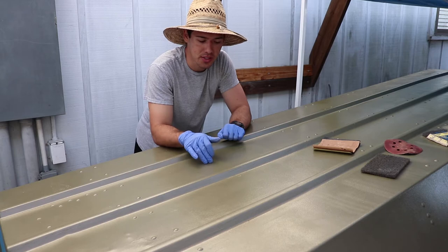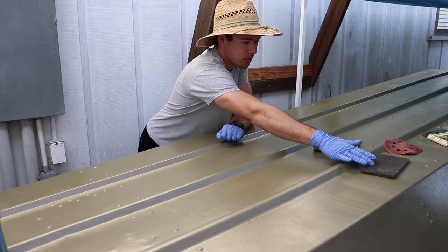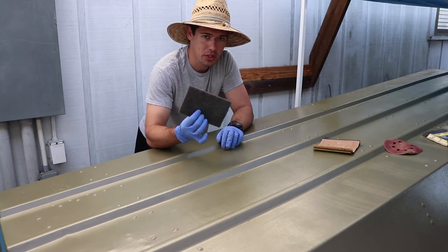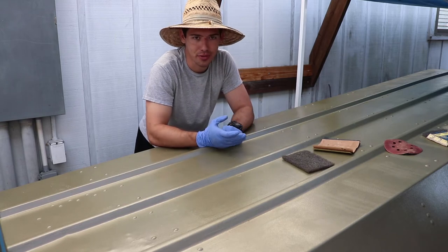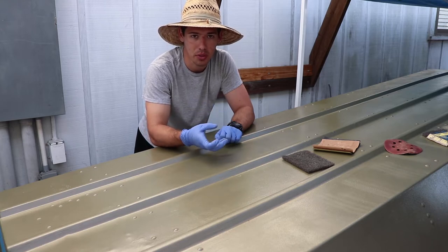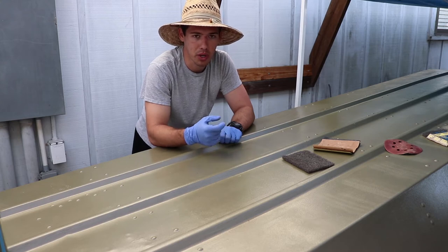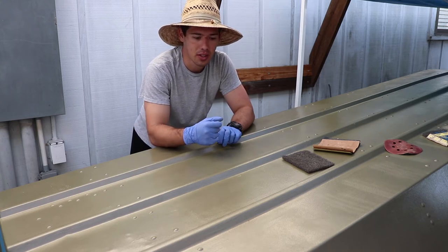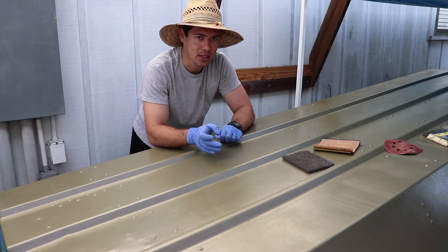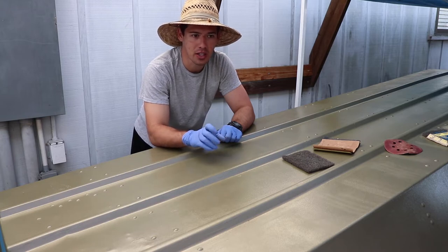This is actually fairly slick itself, so you are going to have to sand it down. They do tell you to use 220 grit to wipe it down. After doing some tests, this seems to be doing good — you can view those tests right here. This will take 15-20 minutes to do the whole boat, because you're not trying to get any of this off, you're just trying to scuff it so that the top coat of the Wetlander will actually stick to it. I'm going to mix it up, use those half-gallon jugs again to get the portions right, and probably won't take any breaks this time. I'm still only going to mix half of it first, and then once I get done with that half, I'll mix the other half.